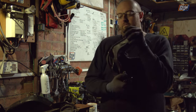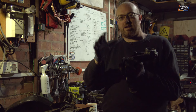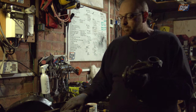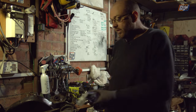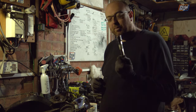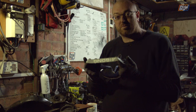If we hold this up the correct way, there is an outer race that holds the hub on, a set of bearings, an inner race, and then another set of bearings and an inner race from that holding everything together. So if we knock the outer race off, we'll release the bearings but we can also get to the snap ring. We're going to do the rear first. I'm going to use the portable dynamic press — which is a lump hammer, a 23mm socket, and a half-inch extension bar. Because hitting chrome vanadium can shatter and explode like a bullet, I'm actually going to use eye protection, because I'm going to be hitting this very, very hard. And I've already been to eye casualty once this month, as has Chris.